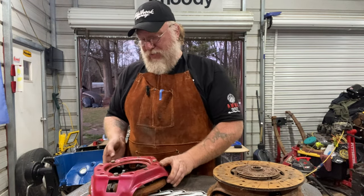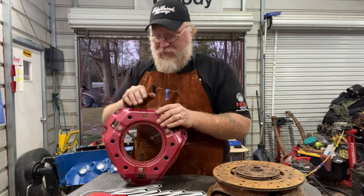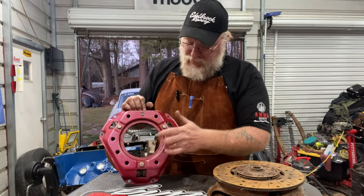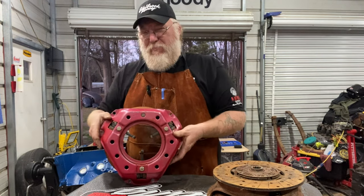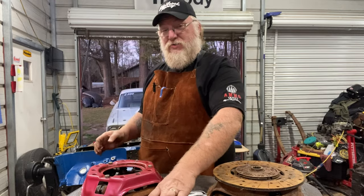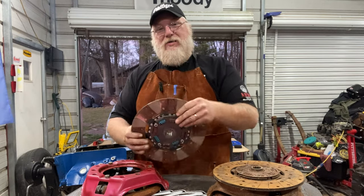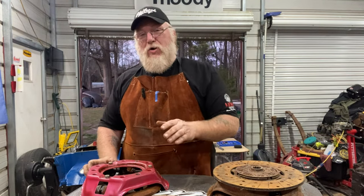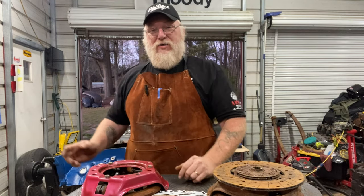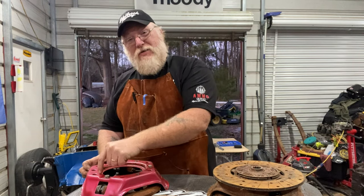The difference in the pressure plate between what I run and this one is that this one is set at a certain pressure - a base pressure - and it's not adjustable. Mine is adjustable. Each one of these holes has a set screw in it that I can turn and change the amount of pressure in the pressure plate. What that allows me to do is, just as the name used to imply, slip the clutch. Not just spinning it in there - just a little. What you want to do is take some of that shock out of the system that would otherwise smack that back tire. By doing this, you can control how hard or how soft that car launches.